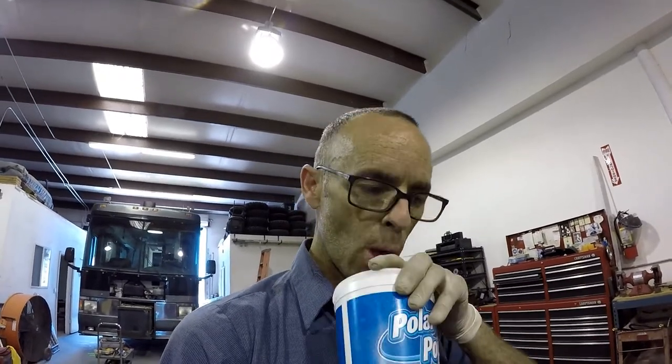I've tried turning the AC off of max air, just put it on recirculate, or not recirculate, just normal, but the vacuum leak persists, so it's not on that servo. So the next more likely place is gonna be the main supply, vacuum supply. So I have to take the dash apart for that.